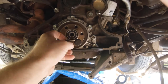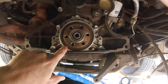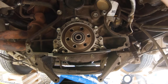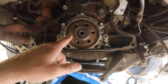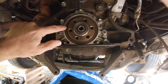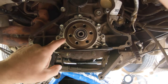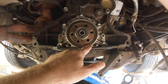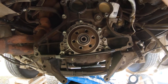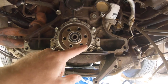I'm gonna double-check this rear main seal — I don't want to take any chances with it being put in wrong. I had originally put grease on this outer edge because the instructions are not very precise. It just says put MP grease, multi-purpose grease, on the seal and press it into place. Being that this part spins, the outside edge doesn't really have to have any grease as far as any spinning goes — there's no movement there. But there is movement on the internal, the inside. So with that being the case, I probably did not have to grease this outside edge; I just really needed to grease the inside. So I'm wondering if that's going to cause any issues and I really don't want to have to open this back up for no good reason.